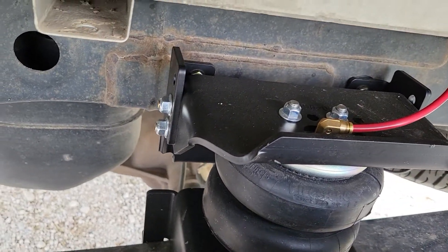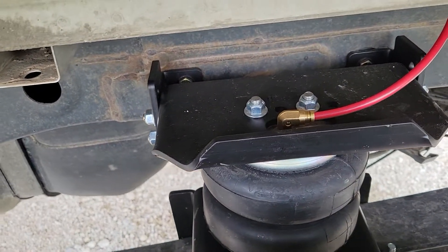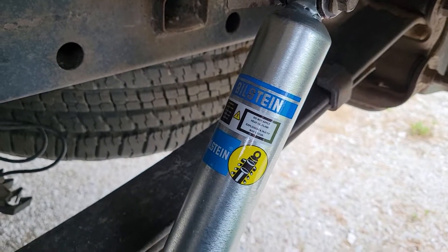It requires some trimming, but in my opinion it's not a ton. It's pretty much all plastic, so we didn't really have to worry about too much since this thing is kind of a work truck. Since it is part of his fleet, it needs to be able to work, so we did a set of Firestone 5,000 pound airbags in the rear to help out when he is towing. The Ready Lift kit also comes with Bilstein shocks in the rear, which will help with the ride quality. Other than that, that is pretty much everything we did to this simple build.